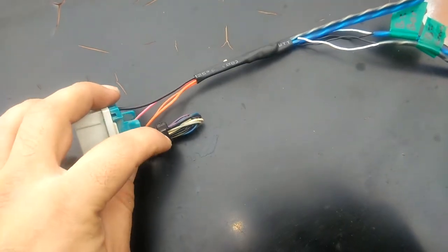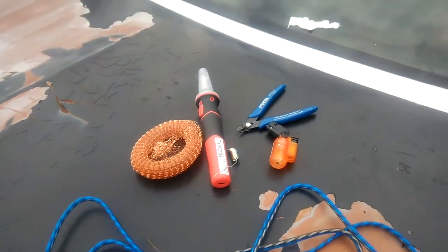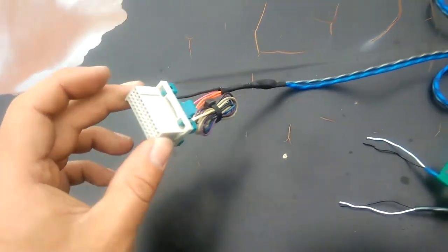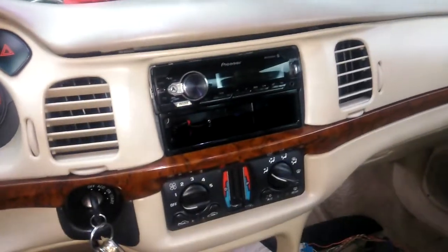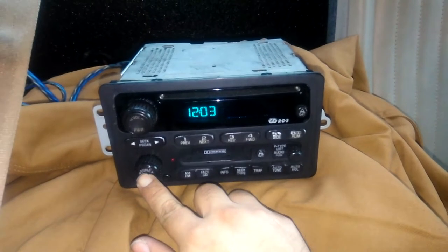So this is what I got — I was able to clean this up and solder these into the corresponding ones. I'm fortunate enough to have a cordless battery-operated soldering gun, but you can do it however — even with tape — just take pride in your work so it comes out good. We got everything cleaned up and put back together. I got the aftermarket in the dash and here's where we got the factory. I'm gonna toss it back there behind the seat — I got a speaker box back there so I'll find some room. Let's put it on accessories and see what we got.